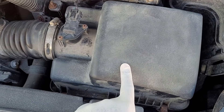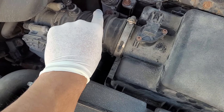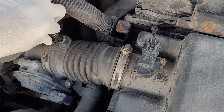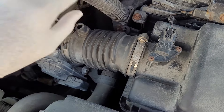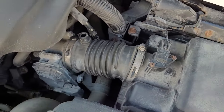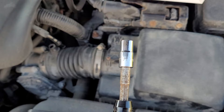Removing the air filter — the upper part and this part of the hose, you're going to have to remove this. It'll wiggle out, so don't try to force it; it's just pressure-fit in there and will pop right out. That clamp there is a 7mm.